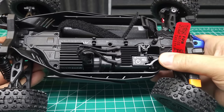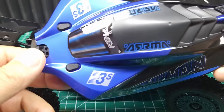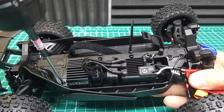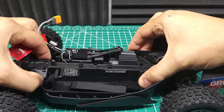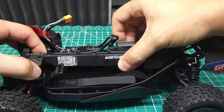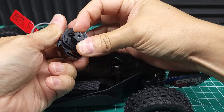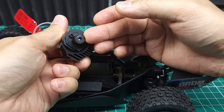Before we do that, we need to see what's under the hood. I'm really curious to see what size the pinion gear is on this model. I just noticed — I was wondering what that 223S in the model name was. It means 2 to 3S, that's pretty clever. If you've never taken one of these center spine braces out before, they can be pretty stiff. It's often easiest just to pull it out with the motor. First look, we have a 21-tooth pinion gear. That's quite a bit bigger than the stock pinion gear, which I believe is 19-tooth on the Typhon.